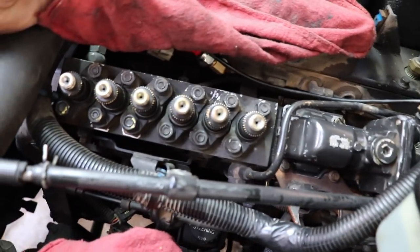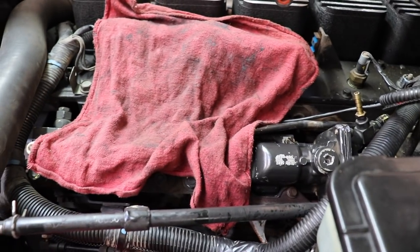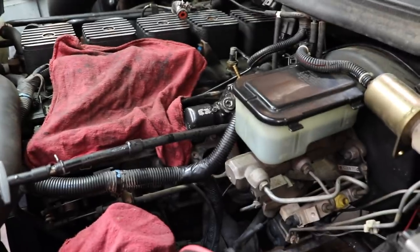So, but anyways, now we've got the delivery valves I installed, the AFC housing springs, then I keep this rag over there because we got birds living in the barn, so they don't drop straw or crap down in there. And I got a lot of work to do yet this evening. However, in the next video, hopefully we can get the governor spring kit done.